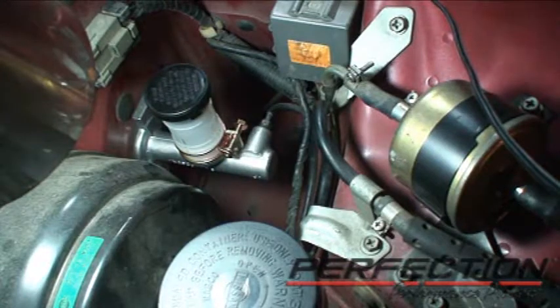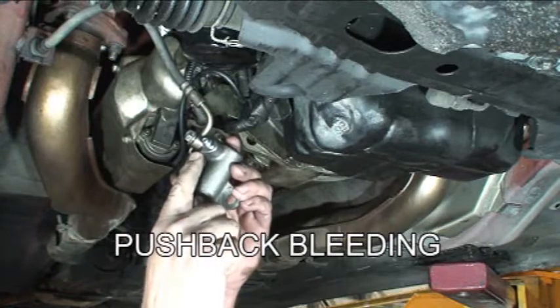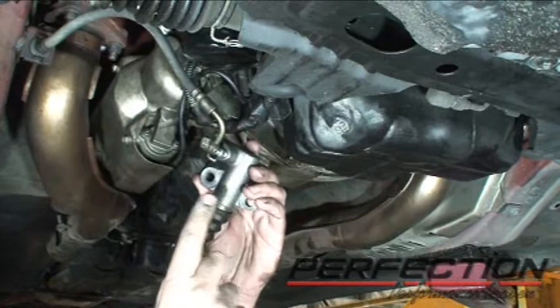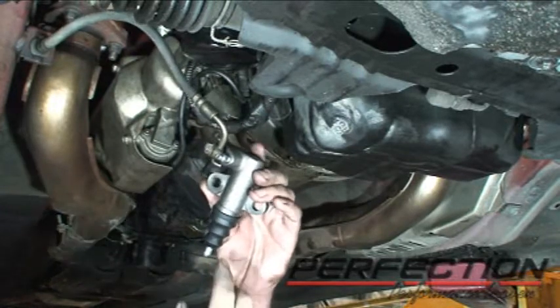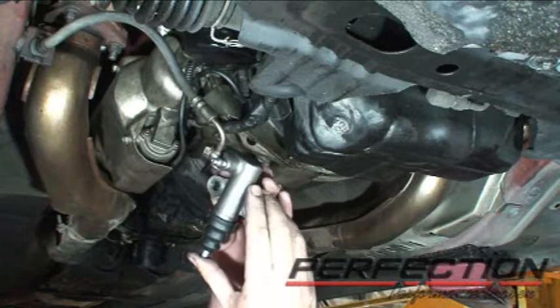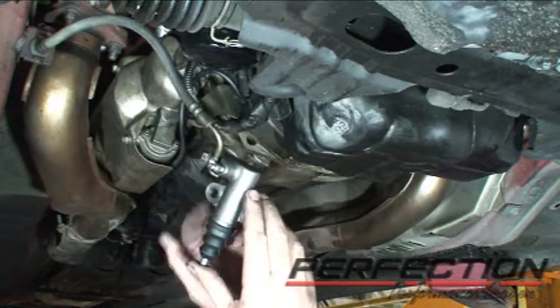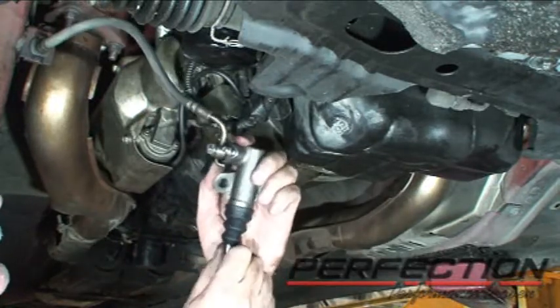Now I have to connect underneath the firewall. The slave cylinder is connected back to the line. There's a copper gasket on both sides of the banjo fitting — that creates the seal. The bleed screw is closed. I put fluid in the reservoir of the master cylinder. Now I'm going to start to push the slave cylinder piston in, and it should push air bubbles up and out into the master cylinder.